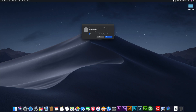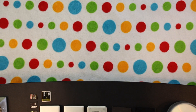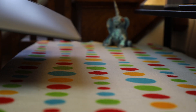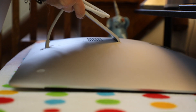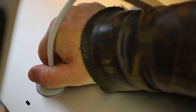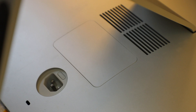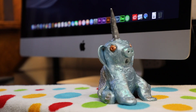First, we have to power off the Mac, then place a blanket or soft cloth onto a flat surface and lay your iMac face-down to allow access to the back of the machine. Then remove the power cord and push in the small button above the power port — you may need to use a small tool to push the button in all the way.